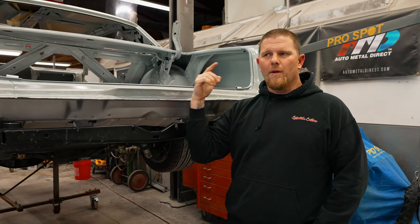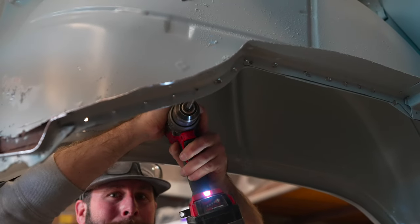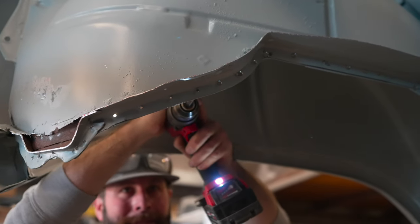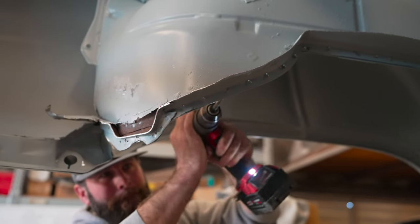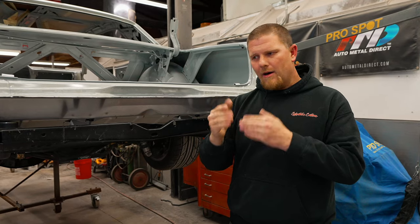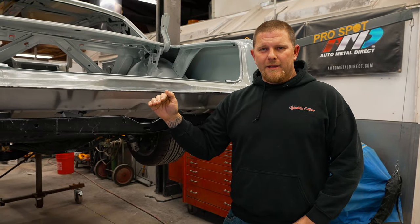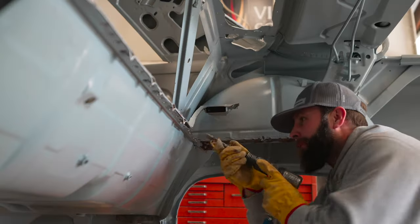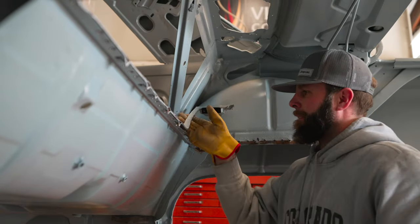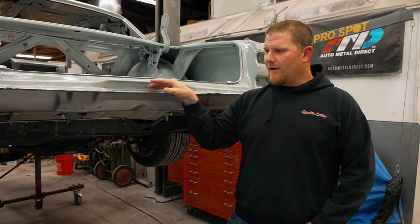As we work around to the wheel wells, we're thinking about what matters. On the inside of the fender well, it didn't matter if Justin drilled right through the whole thing because the trunk pan is not going to get reused — you need that actual hole for the plug weld to be reinstalled on the wheel seam. So it was just faster to drill right through it and use your panel buster to break it apart. In some seams, if you have the majority of plug welds out, you can — with pressure turned down — use an air chisel, sometimes called a burp gun. It's a pneumatic seam buster, but be careful not to rely on it too much on a crucial outside panel or you'll bend it up and have to do metal work to get it back straight.